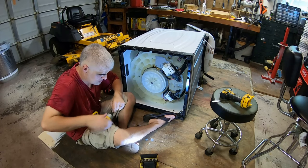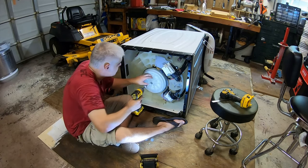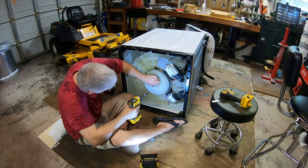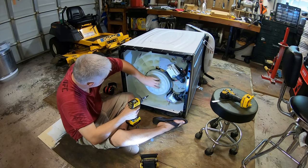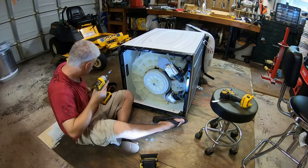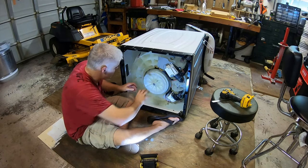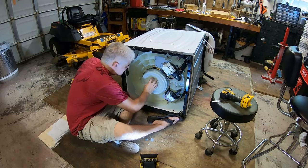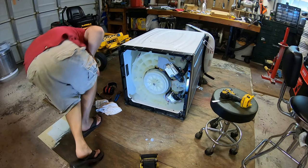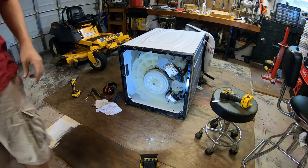What you're seeing there is Lenz's law. So there's a braking effect. Pretty cool. When you spin a coil, or a spinning magnet inside a coil, that produces a current which opposes the motion, or it induces a current in the coil that opposes the movement of the magnet. So now we turn it in reverse, you get a lot of resistance. So I'm assuming there's something up in that computer, maybe a capacitor or whatever that we're charging, that makes it difficult to turn. Sorry guys, I'm a little bit tongue-tied.